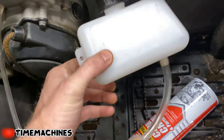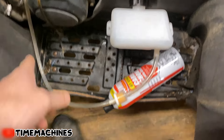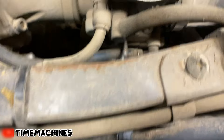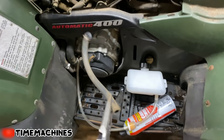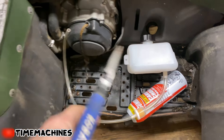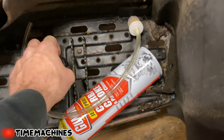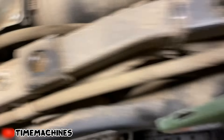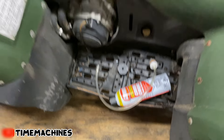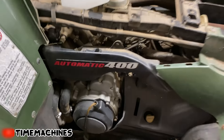Let's see if we have to clean the carburetor - I'll put a little gas to it. This little gas can was four dollars online on eBay or Amazon. I put a line and filter on it. You go to the inlet of the carb, pull off the line, and put this one on so I can funnel it some gas. I fill this bottle with the filter and long line for a reason because this is about three-sixteenths and that is a quarter, so if it doesn't fit I just pull the filter off and run it that way.